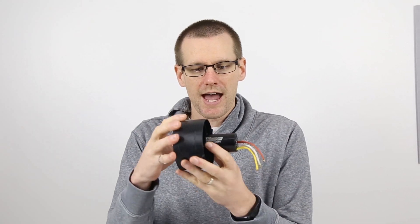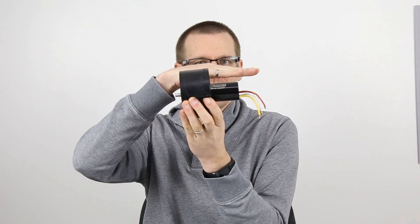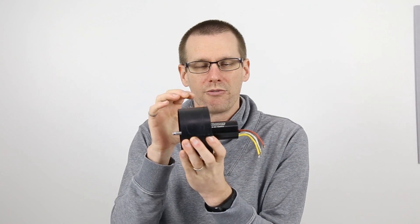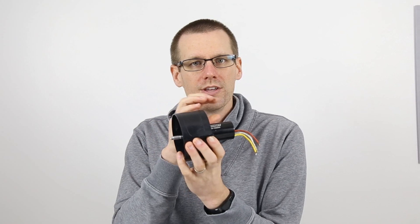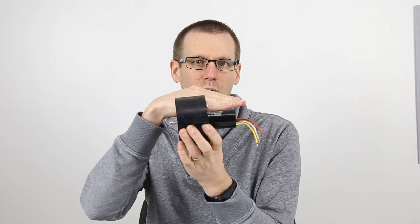Welcome back to another video here on the channel. In this week's video we're going to be taking a look at this assembly. The motor does look like it is sagging here in the rear end, and that is true because what happened is this motor got so hot that it essentially welded itself to this electric ducted fan case, and during that process the motor ended up melting the case to a point where it actually now is hanging down.